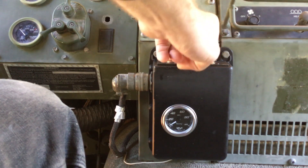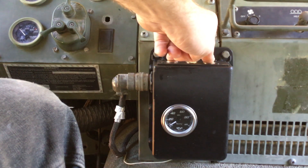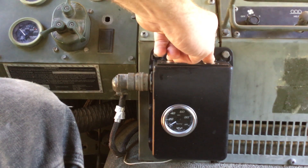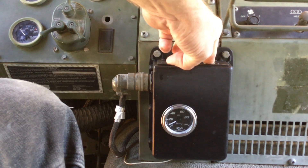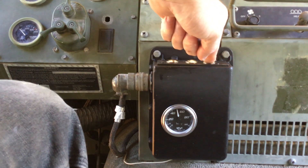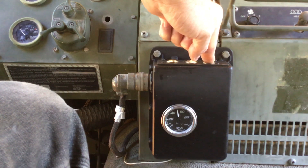We'll let this run for a little bit. Unfortunately, when you're deflating, you can't see what the active or current tire pressure is. But it's easy enough — if you want to check where you're at, let off the deflate button, give a little shot of air to close the quick release valves, and there's your current tire pressure. Looks like we're right at 50 PSI.